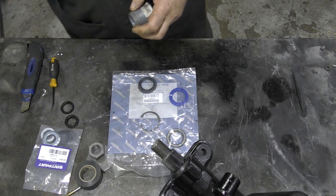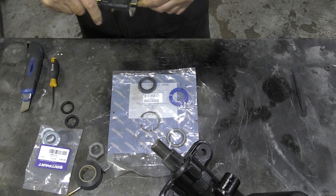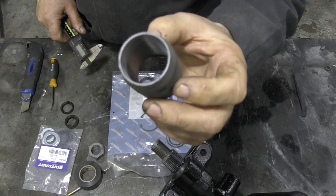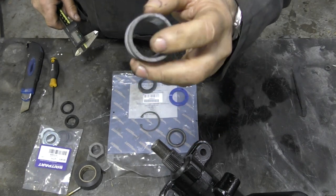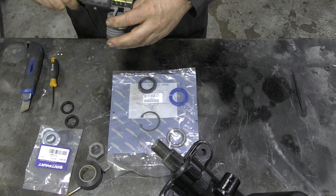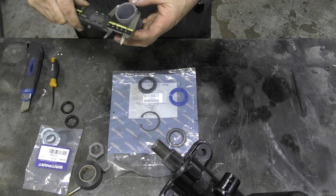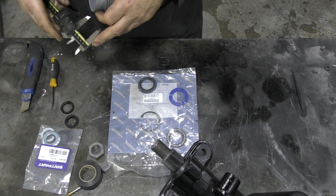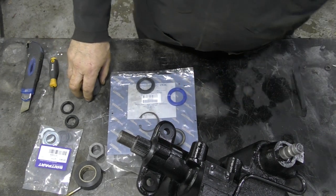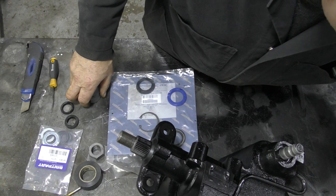Fitting the seal is a bit tricky - I got an email from a chap who said he had great difficulty fitting the seal. I got hold of a piece of plastic water pipe connector - a reducer - and the sizes were absolutely fantastic. I cut it down. The inside diameter is 32.8mm, call it 33mm, and the outside is around 40mm. Bear that in mind.